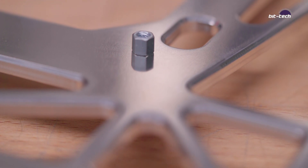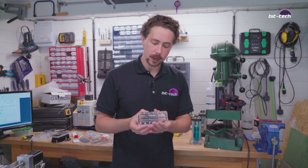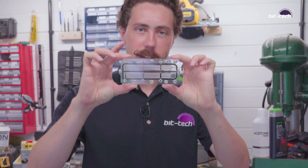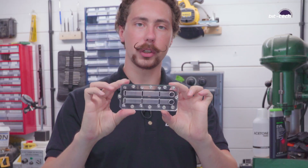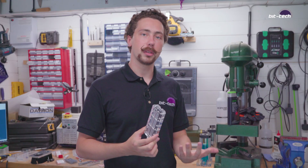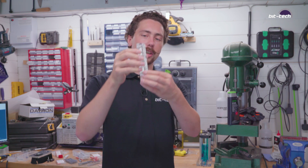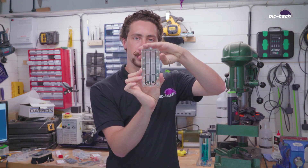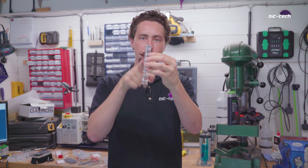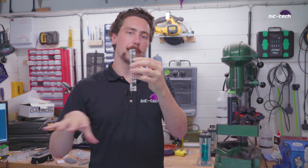In addition to the aluminium work we've also got a lot of acrylics. The first thing I made yesterday is a custom SLI terminal for the graphics cards, because the stock one — although it looks very nice — doesn't really fit with the theme since it's made out of black acetal. I wanted an acrylic one and I also wanted the ports to come around the back, so it's going to sit in this orientation with the graphics cards flush on one side and the ports running back into a distro plate along the bottom.